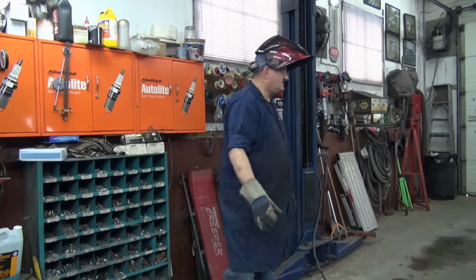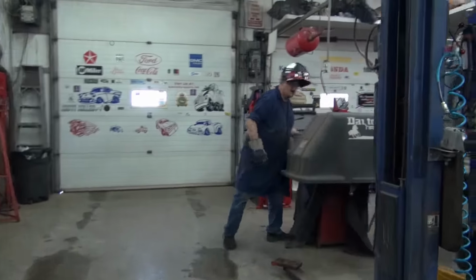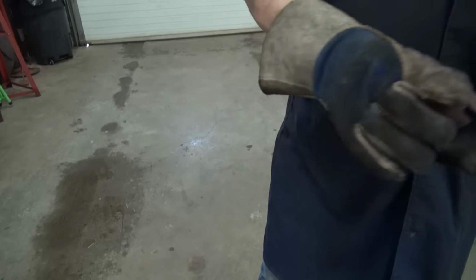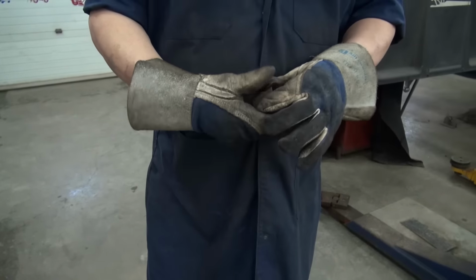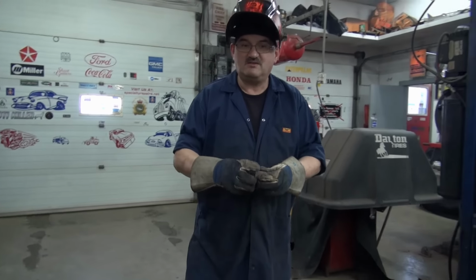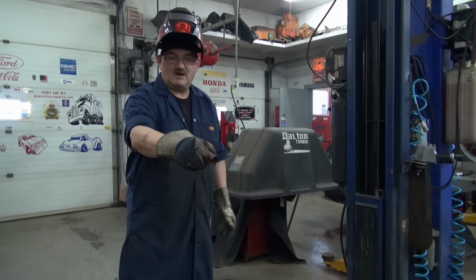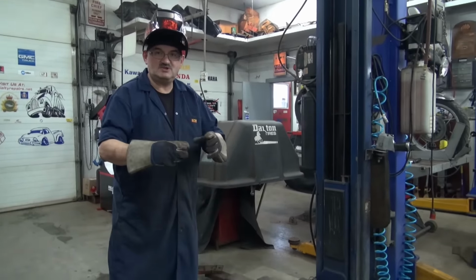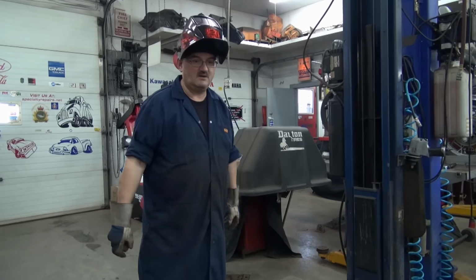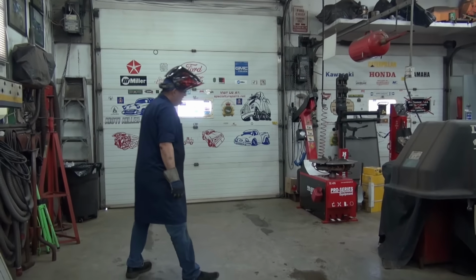And I mean, those mufflers, when they took them apart, they had all kinds of bushings and spacers and shims put in there. And there was shim stock and everything put in there, like even metal, not tinfoil, but metal wrapped around to make it tight. But when I made that manifold, I ended up making it the same shape as the muffler. So it's going to be one clamp, none of this anymore. That's the way to go, right? Yeah, better fit.